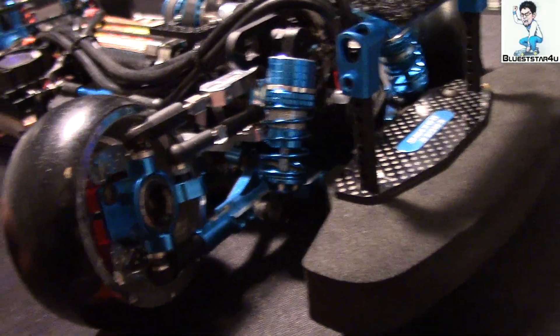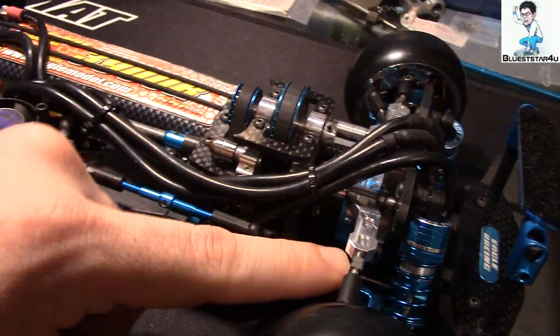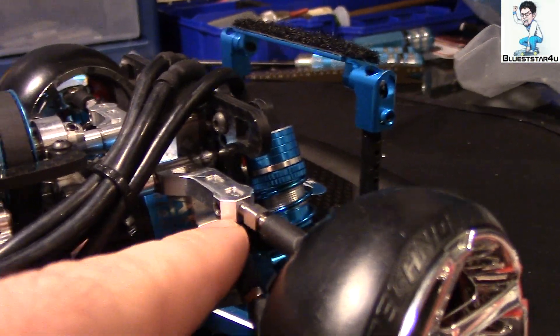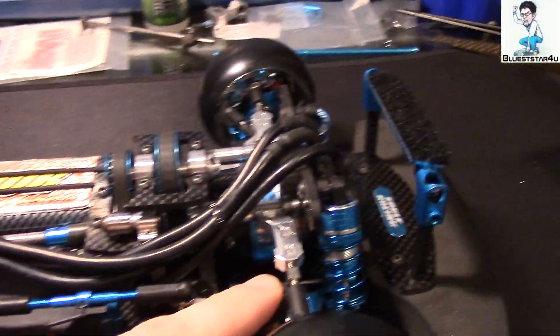Take a look at that right there. Of course you're using the Eagle Racing knuckles with the lower control arm. The upper control arm has changed, and just like the other ones, you can take out the screw right there and adjust it with your camber tool, then tie it up when you're done.